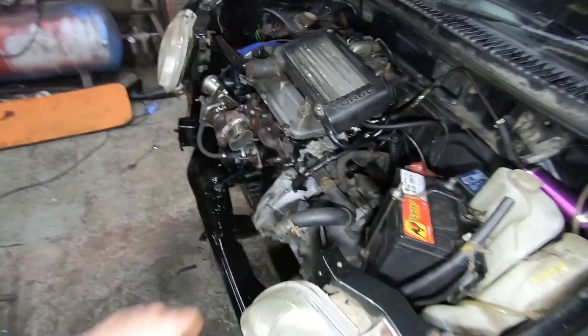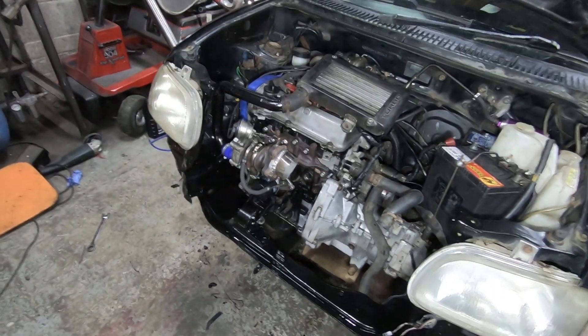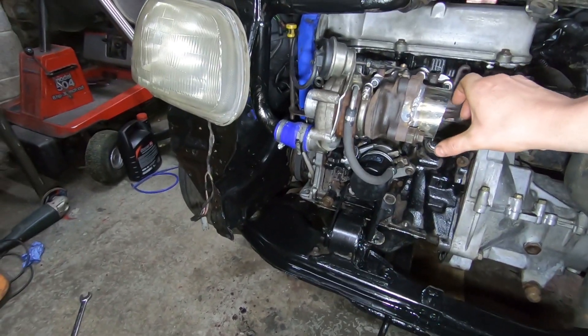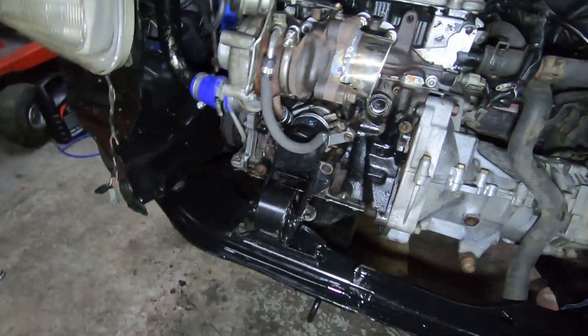What I'd also like to do is try and make a start on this downpipe — in fact that'll probably be the majority of this video. So we'll get the massive saw out and cut some pie cuts because I don't have any mandrel bends for this. Basically we're going to come down here, round here, down and through that hole there.